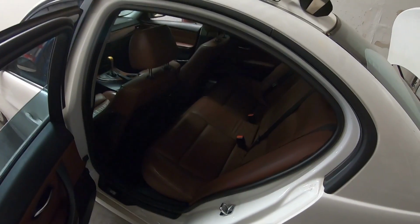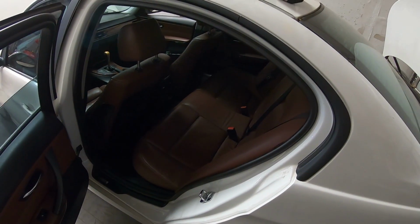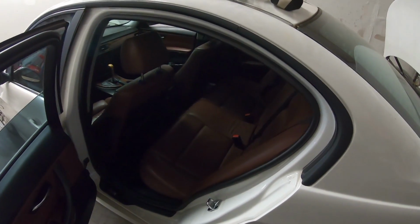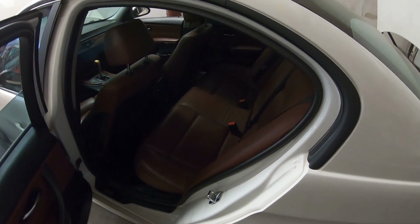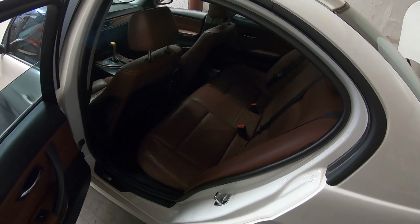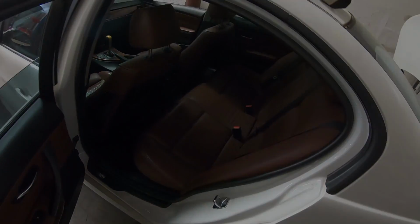Some of the guys coming from an N54 setup that already have a low side fuel system, basically it's a 450 or two 450s in the tank. You can use that system as is, because most of them already take advantage of all the plumbing that's in the tank as far as the Venturis and the lift pumps or the return pumps to the pickup side of the tank. So whichever option you do, you just need to make sure you don't disrupt that stock system, or else you'll only be able to use about half a tank.